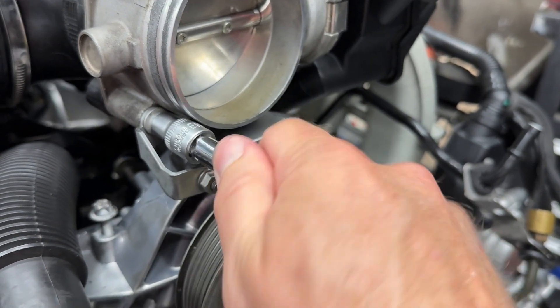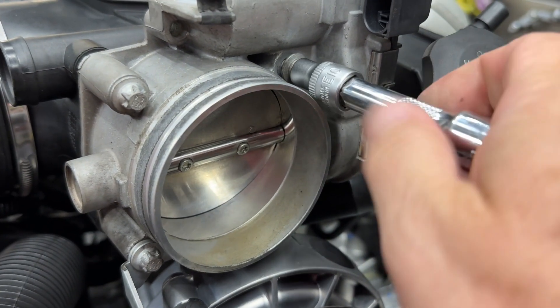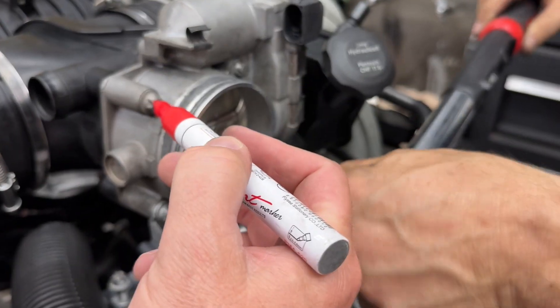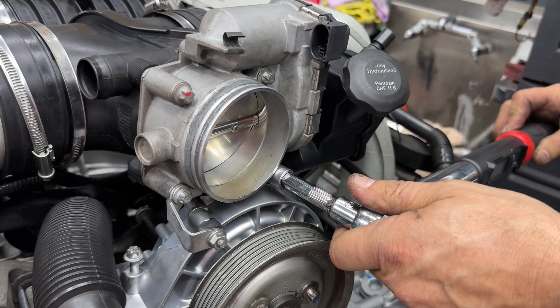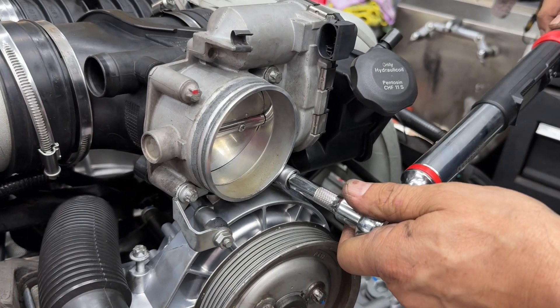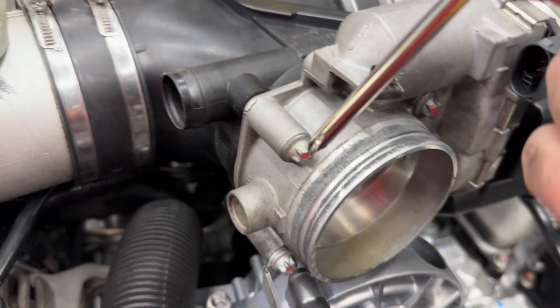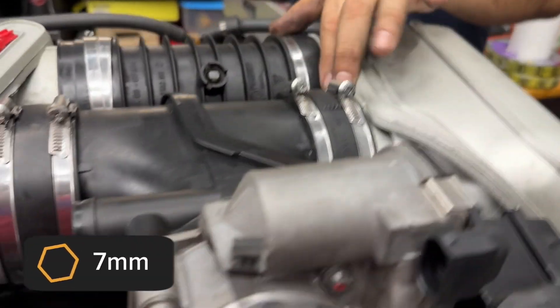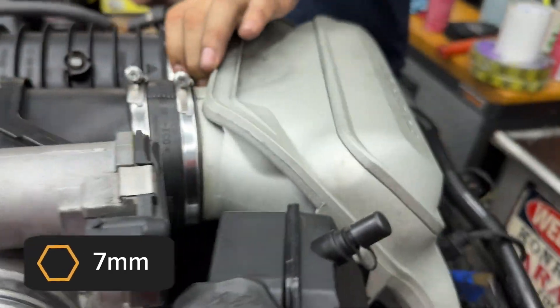Put this thing back on — we've got three bolts and the fourth bolt also goes through a little bracket right here. These are E10s and they get torqued down to 10 Newton meters. Got a lot of people working in the garage today. After we got these four tightened up, coming from this direction, they are seven millimeters.